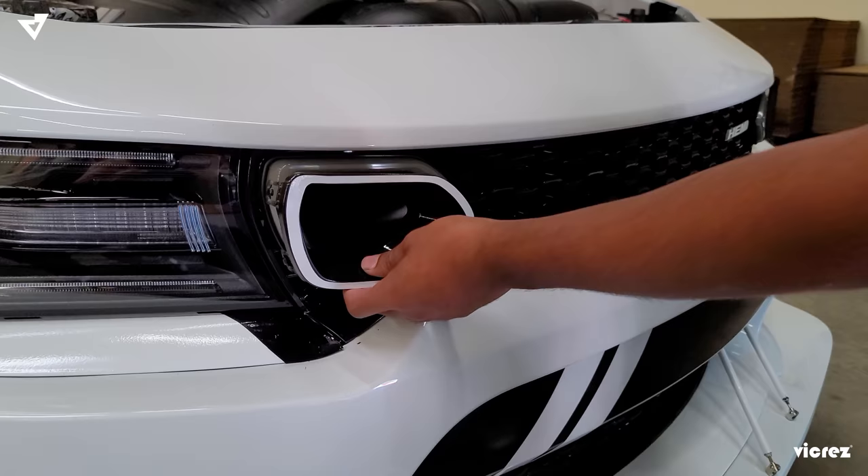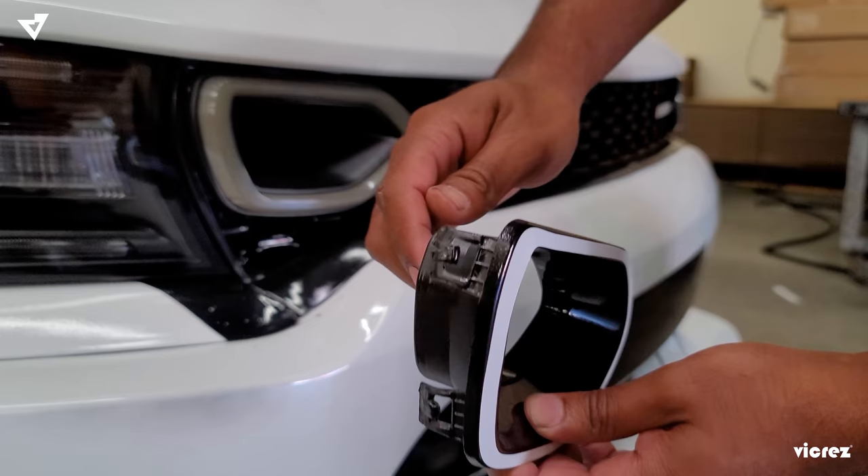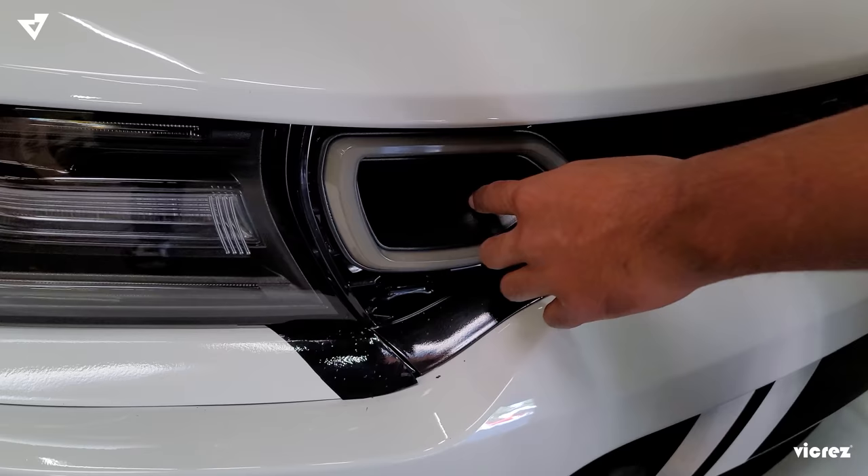So once that's done and all the pushpins are out, the next step is to pull out the snorkel. The snorkel is right here. In order to pull it out, there's going to be these tabs right here that you have to push down and then pull out at the same time. Some of them might crack a little bit, but you'll still be able to use it once you take it out.